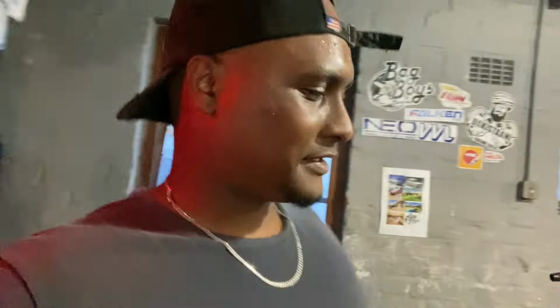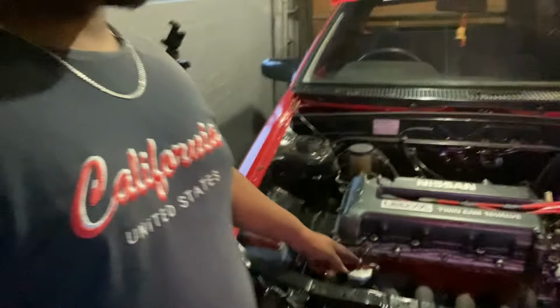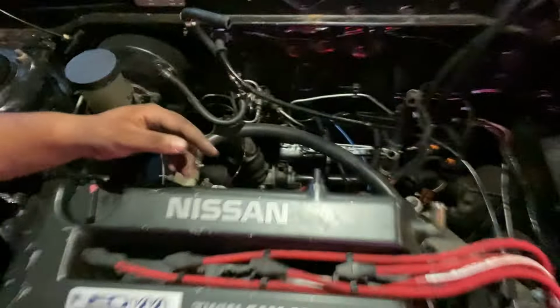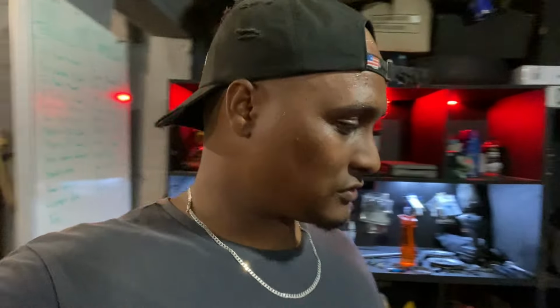You're always forgetting something. Yeah, so I got the intake off. We also need to take off this branch and the exhaust. And the reason for that is at the back here, where we're going to work on that mount, we're going to need the space because the holes are threaded in the box. So they're going to need the space to be able to re-thread that hole. So the exhaust must come off. I must pull the loom back through. I didn't disconnect the battery, which I should have done first, but yeah, didn't disconnect it.